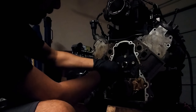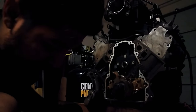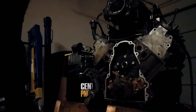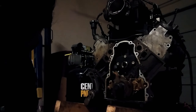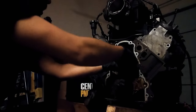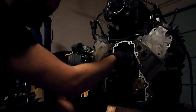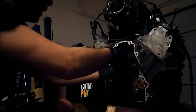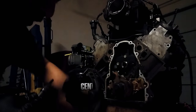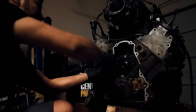If you haven't seen my other video, check that out — it gives a quick overview of what I'm doing. What I'm going to put in here is a 595 lift cam, intake and exhaust, 112 LSA. I'm not going to degree it or advance it two degrees or anything fancy — just gonna put it in just like if it was an original one.